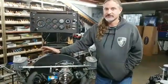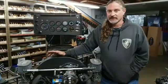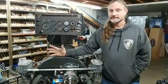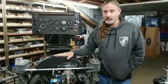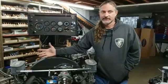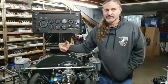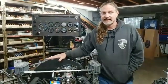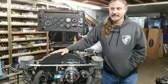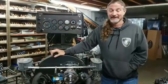The only other thing I can suggest is if the engine's out of the vehicle and your project's not done, have the rockers off, do your trick with the Marvel Mystery Oil, and then literally bag the motor. Now, if the engine has never run before, you're probably okay leaving it alone if it's never had gas in it. In that case, I would still pull the rockers off to get the pressure off the springs, make sure all the valves are closed, take the spark plugs out, maybe squirt some Marvel Mystery Oil in there, and then put the plugs back in. The biggest thing is to seal the thing up — put bags over the air cleaners — whatever you can do to keep the moisture out. Water's not our friend, and air cleaners flow water as well as they flow air, so keep that in mind.